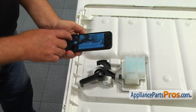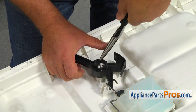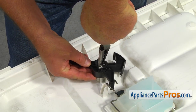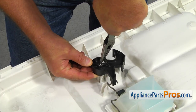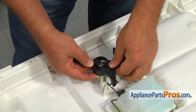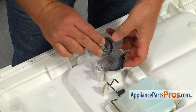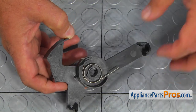Remove the inner door. Take a picture of the latching mechanism and then, using the needle nose pliers, squeeze the tabs at the end of the shaft and slowly push it in to release the dispenser lever and the spring.